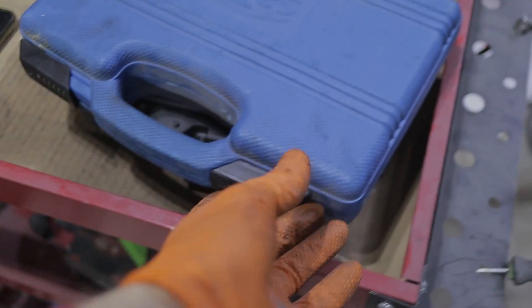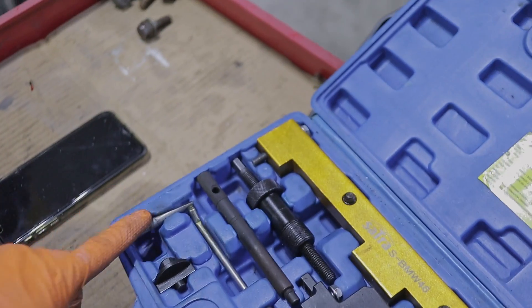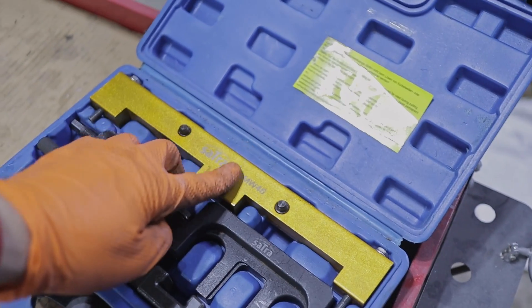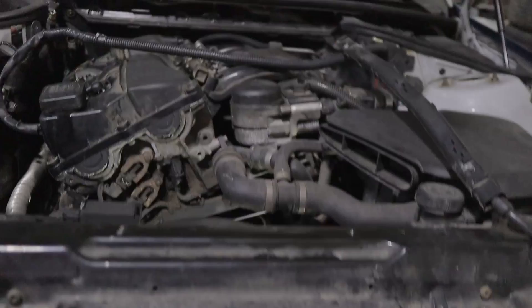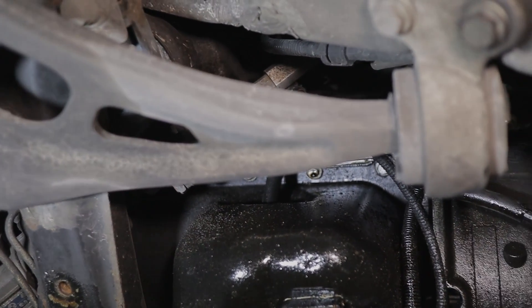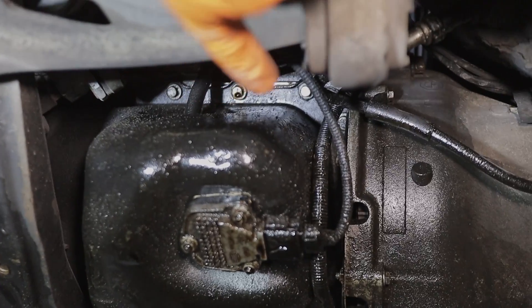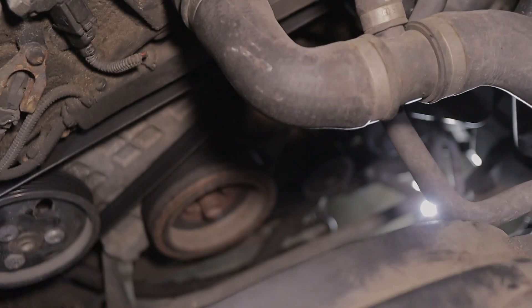Next I'm going to take my timing gear and put the first locking pin in the flywheel — it's under the car. So this is the flywheel locking pin, this is the tensioner, this is for the Vanos plates, exhaust camshaft, and intake camshaft. Right there above the oil pan we have a hole which we put the locking pin through to block the flywheel. Then we put a 22mm socket on the crank bolt and rotate the whole thing to align it.